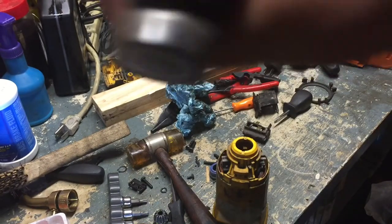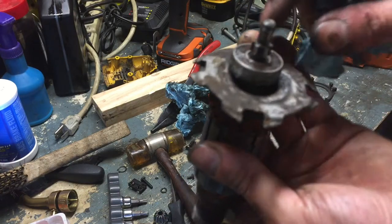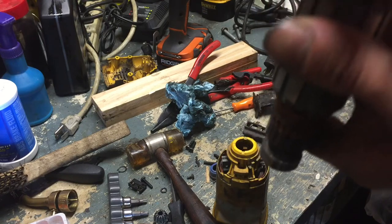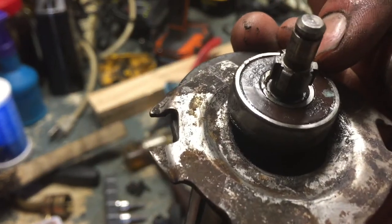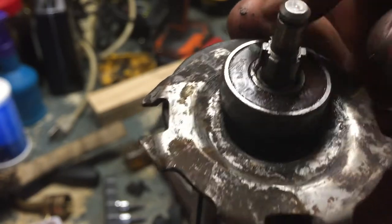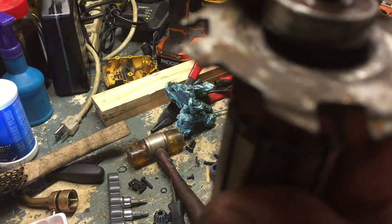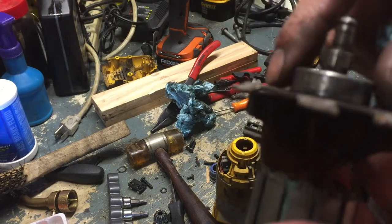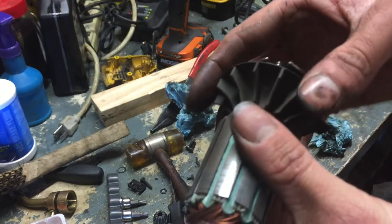That's the one on the tail end. Now if we go towards the face, it seems like it has a rubber seal on it, so it's probably a higher quality bearing. This rear one just has the pressed-in cup as a seal. This front one is USA made and has a seal. You also have this fan cooling and the rotor windings.